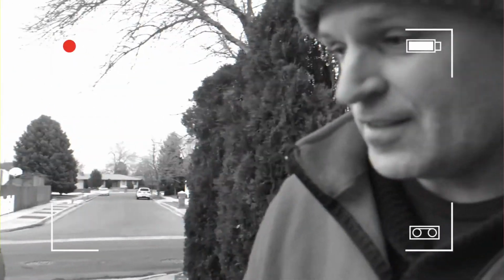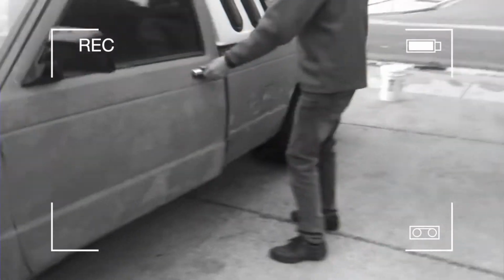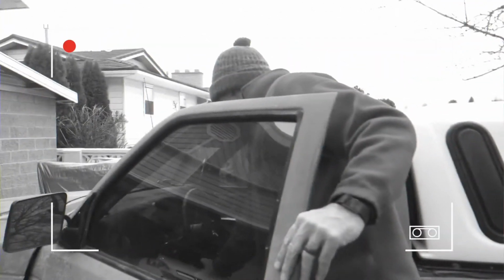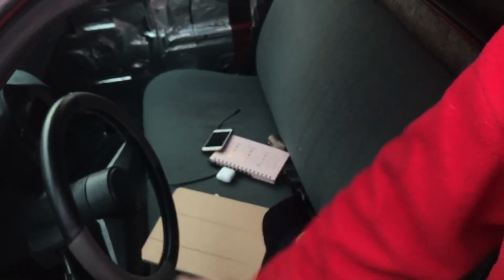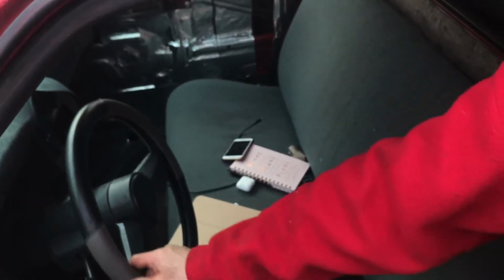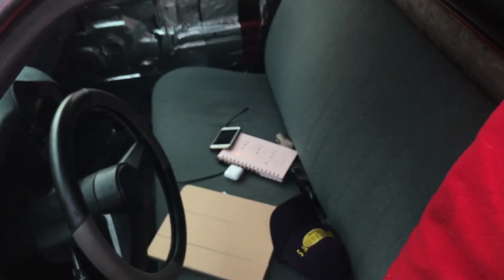Oh, I forgot to check my steering wheel. I should have my cameraman in the car holding the steering wheel straight. I'm recording. Yeah, so now we've got to fix that. And that's why you pay $100, so you don't have to spend 2 hours doing this. That's why you don't jack the front of the car, because the ground will hold it pretty sturdy for you. But you really should have somebody in the car holding it straight. Okay. There's enough play in it from there to there that I'm going to call that good.